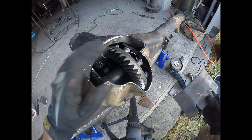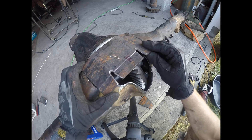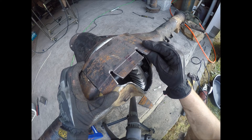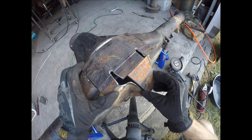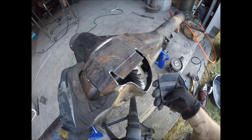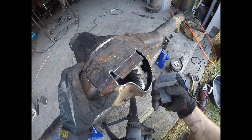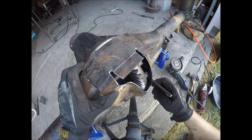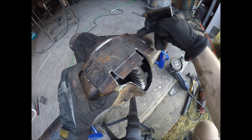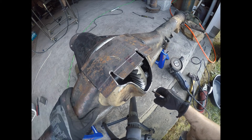Cut it level with the back of this, so when you put these plates in there and it's touching the gear, you don't want that — so you just pick it up a tiny bit, tack it in place, fold these down. Put this one on the back, same thing — keep it off the gear. You want to maintain at least a quarter of an inch of clearance for the oil to do its job cooling it. And I'm going to move the fill plug over here to the passenger side.